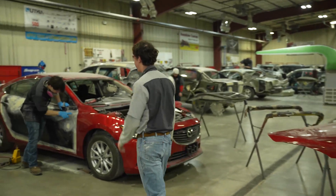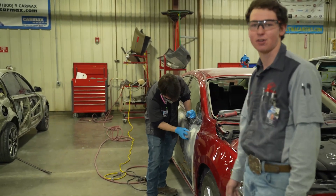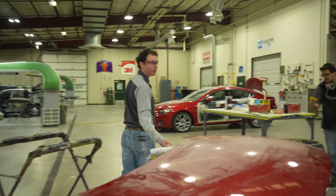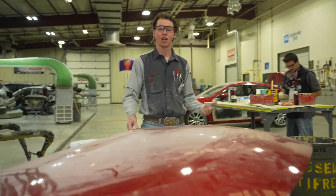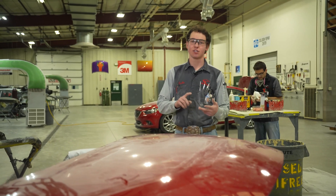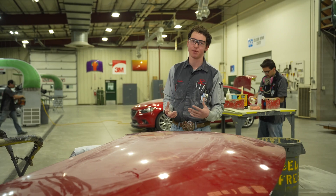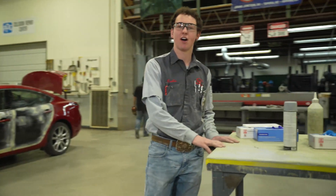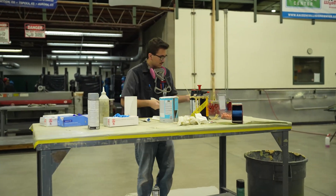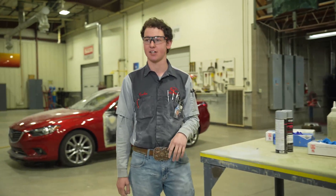He's working on a dent right now that we got from one of our instructors with a good hammer, and hopefully in the next little bit that'll be restored to feel just like brand new. As we keep working our way through, you'll see a bunch of hoods throughout the place. We do a lot of bolt-on for your comp vehicles — we end up taking off the hoods, the trunks, all the doors including the whole insides, and even window replacement. This is our chemical table — it's got all of our body fillers, all of our sandpaper, and grease remover. At the end of applying all of our body filler, we come back with a jar of acetone and start cleaning off our board so we're ready for the next step.